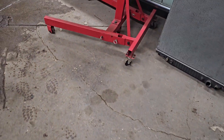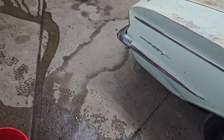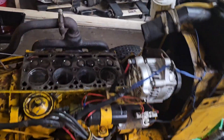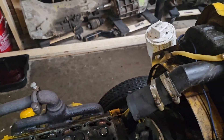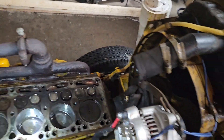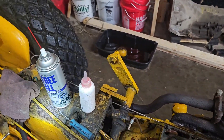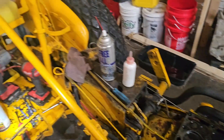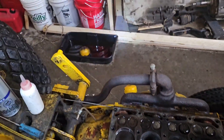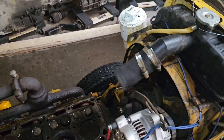Alright, stayed a little longer than I was planning. We flushed the cooling system as good as I can. I cleaned the bores, hosed them down in WD-40 to prevent flash rusting — same thing on the surface of the head — blew all the water off so it's not gonna flash rust. Then I took some Free-All, which I really love. Free-All and Kroil are like the best products. The only reason I buy that Blaster is because when it goes on sale it's cheap — it's okay, but Kroil and Free-All are the best I've seen.